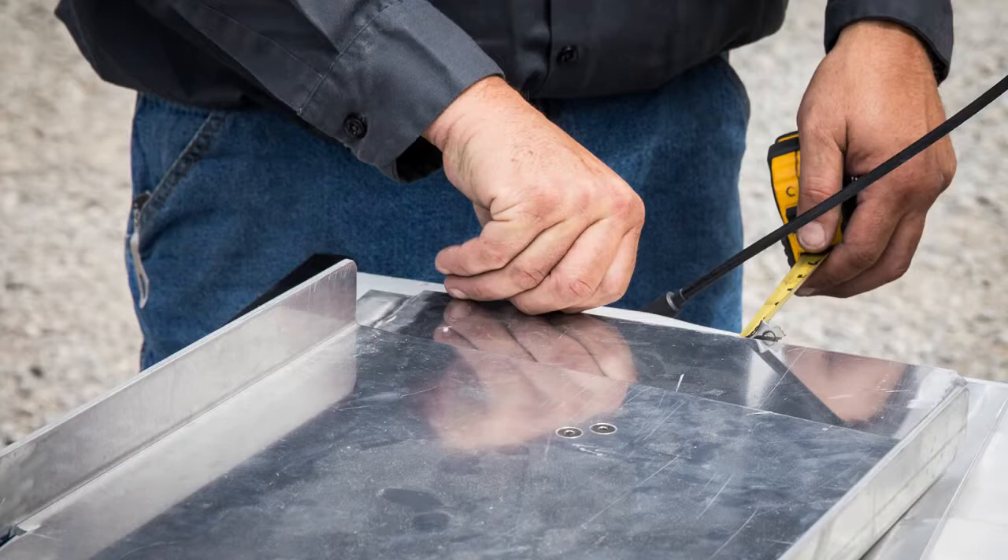Place the base plate onto the tailgate with the flanges down and the key slot running vertically. The plate should be approximately one inch from the front edge of the tailgate and one and a half inches from the side edge. Please note: if the tailgate has a plastic bed liner, it should be temporarily removed from the installation area. Rhino liners do not have to be removed.